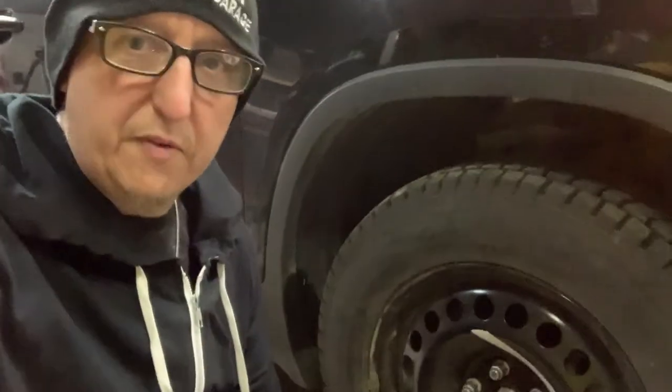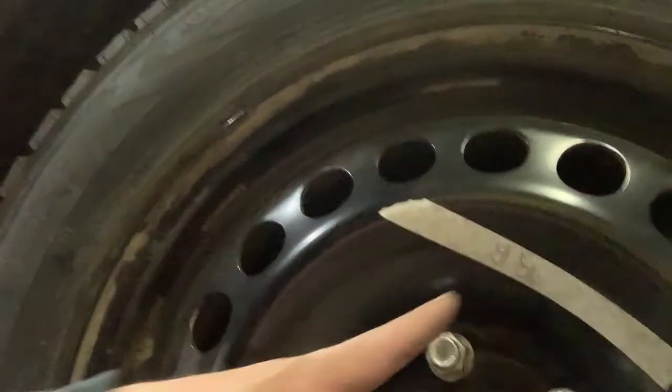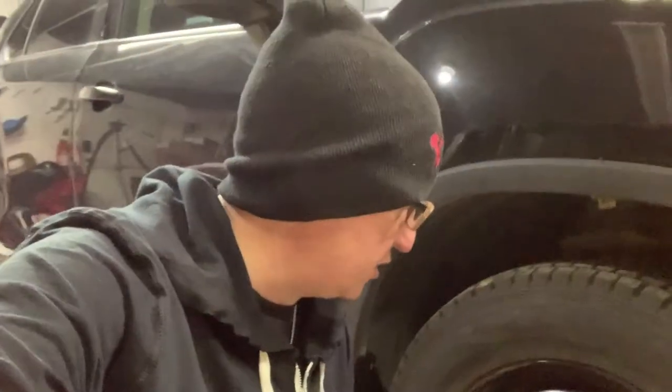Okay, now that we got everything done, I just showed you guys the tool. We just programmed the sensors. Now we can go around to all the wheels and we can remove the little stickers I put on from last year. If you notice, I put little stickers indicating as to what tire this actually was. So last year, this was the right rear. And what I've done is I've put it on the right front and I did the same with the left. So I'm gonna go around the car. I'm gonna remove these stickers and I'll see you guys in the back.